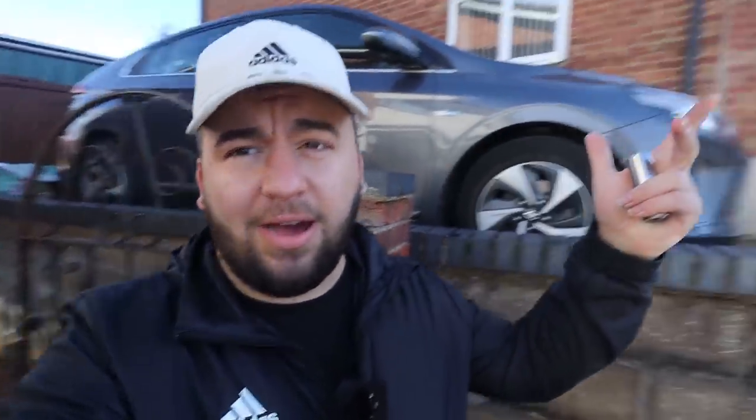Welcome back - it's been a couple of days since I last filmed, purely because of the weather. It's been on and off raining, and I got absolutely soaked 10 minutes ago. I've now got myself to the stage where the gearbox is ready to come out. I've double-checked that everything is unhooked, so I just need to support the engine from underneath with a jack, put a support under the gearbox, remove the last remaining bolts, and wiggle the gearbox out.